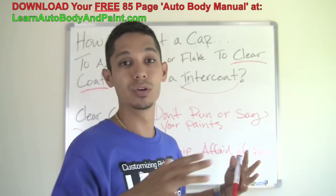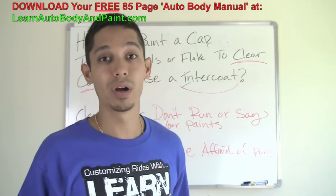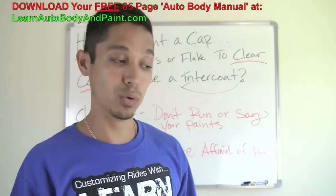That's three stage. Two stage, do your white base, mix up your clear coat with a little bit of pearl in it, two coats of clear, three coats of clear, done, with no runs. The pearl's not going to affect the gloss of it, and you don't really have to put a clear coat on top of it. I've done many custom jobs without putting a clear coat on top of it, and I've done many with an extra clear coat on top per customer request. So you could do it either way, all right?